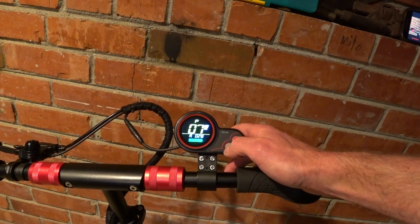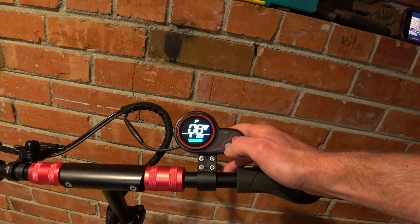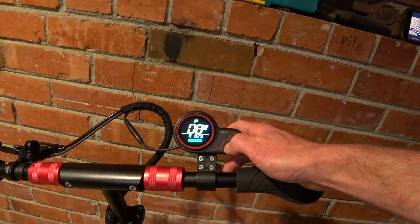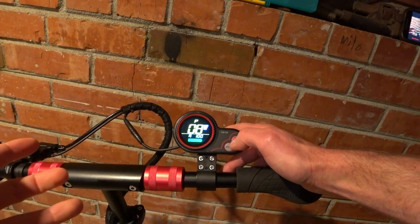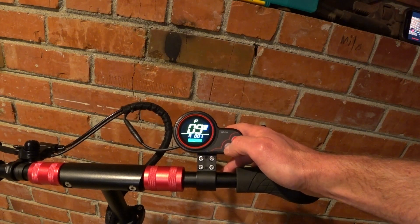P7 is the number of magnets in the motor. The guidance document says it's 28 magnets. P8 is power level, zero to a hundred. You can go in 5% increments starting at 5%. When the scooter came to me it was set at less than a hundred. I liked that customization — you could limit the power and somebody wouldn't really know, if they were more of a beginner.